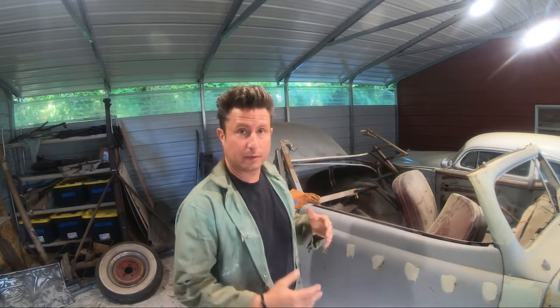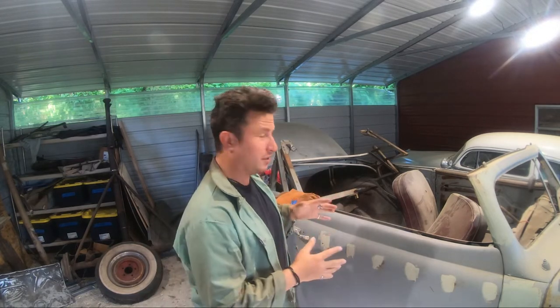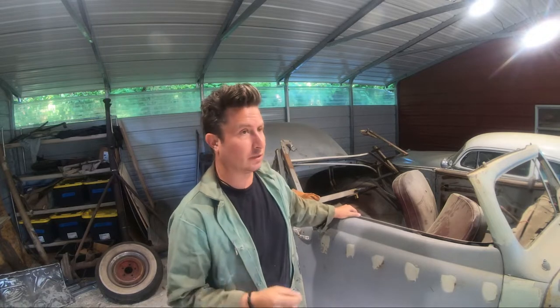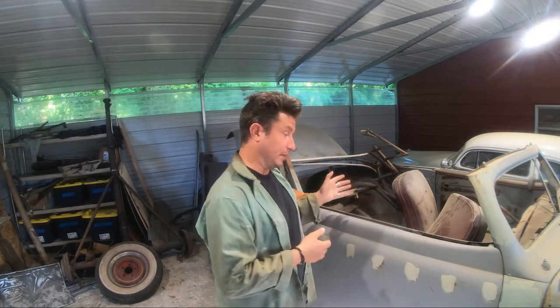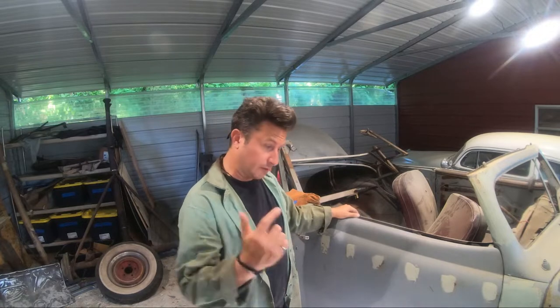It should be more than strong enough and rated to support this car. We'll get into what kit I'm using — I bought this all as a used pile of parts — and we'll get into the whys and wherefores as we go, because there are a couple of really good reasons why this might be the best setup as opposed to the transverse rear spring, which was the setup I intended to use and invested quite a bit of time and money buying parts for.